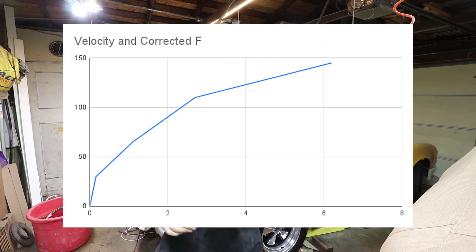One of the interesting things when I measured the compression — I did see a digressive nature in the performance. As you go up in shock speed, you actually see less force coming in. That's something a lot of people aspire to. Bilstein might have included that in the shock as just current technology. I'm not really sure how that works, but at least I was able to figure out what I'm putting on my car.